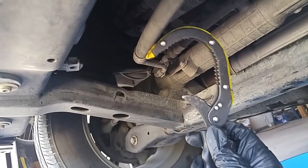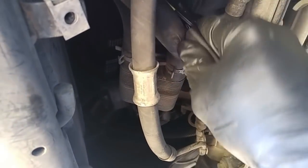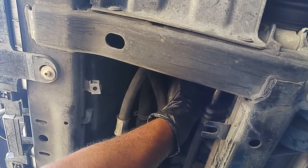Now for the oil filter. I'm using an oil wrench. These little lines right here are just your cooling lines to cool the oil, so you simply move them out of the way, get your wrench around, do one little turn, and then you can loosen it with your hand. I just loosened it — I broke the initial seal.